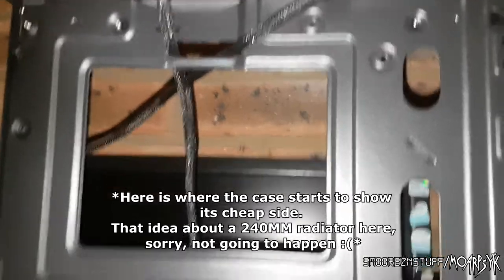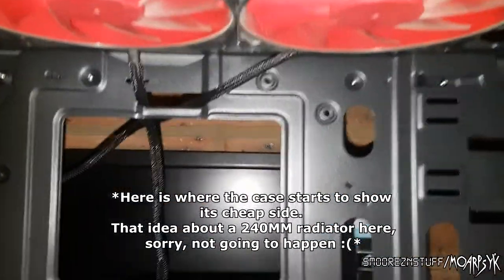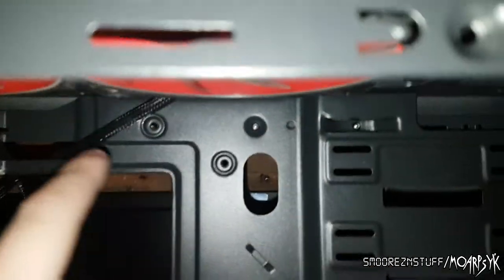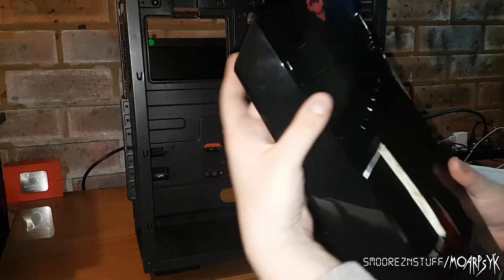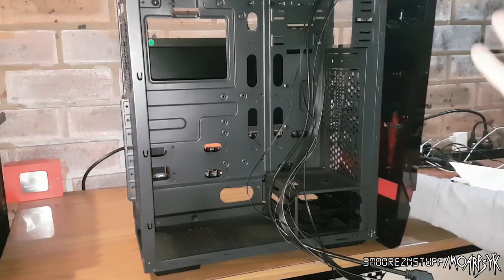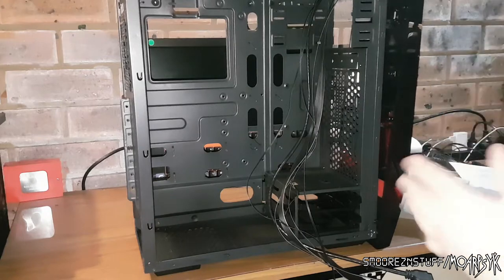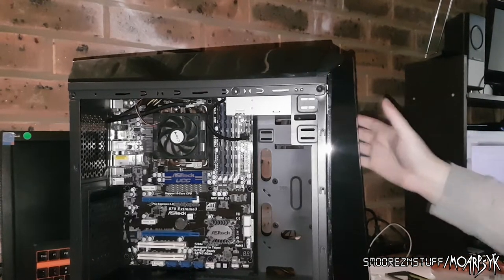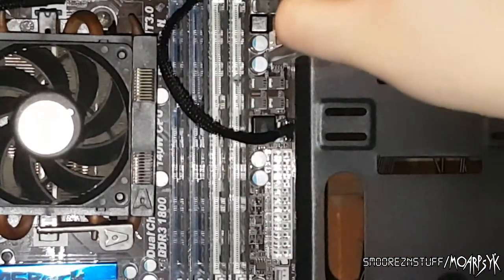Starting to assemble the PC, I've run into a problem. I've installed two 120s at the top, but the ATX motherboard mounting points leave absolutely no room for a 120 or 240 mil radiator up there — that's a downfall. The stealth bay cover works nicely and pops in and out cleanly for a five-and-a-quarter inch drive. However, with a full ATX board installed, the five-and-a-quarter inch drive bay is hitting the capacitors or RAM, and the front panel isn't going on properly — it's half on and half off.